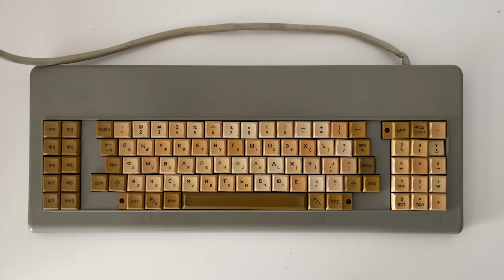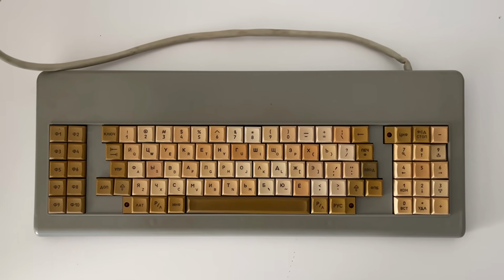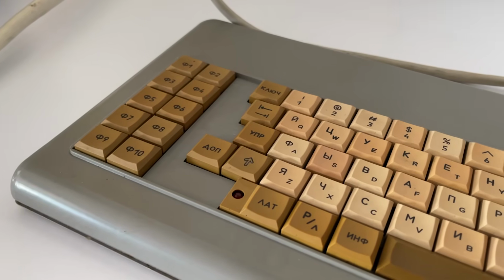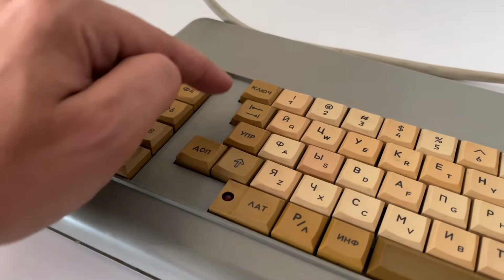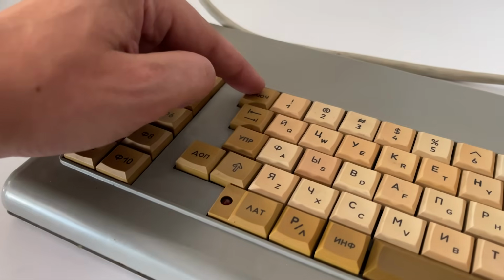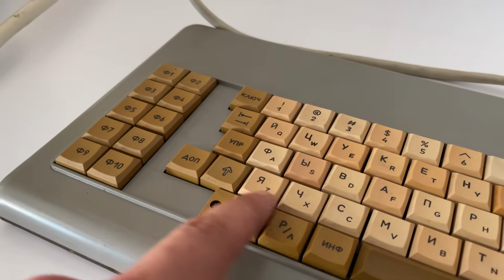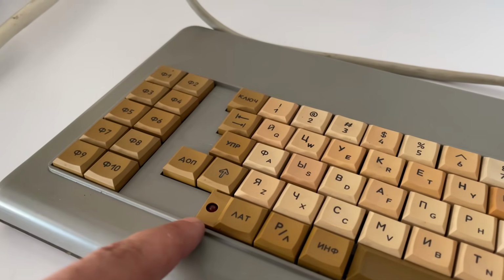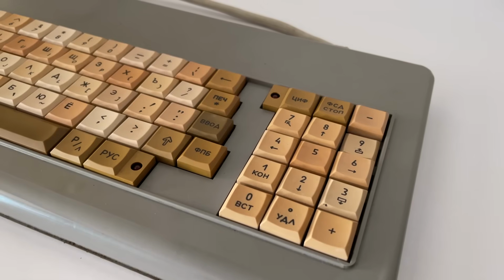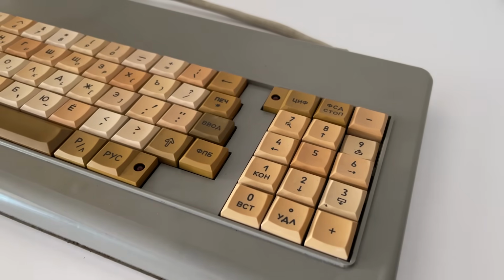And a few words about the keyboard, because it's a little bit unusual. It's a Soviet rework of a PC keyboard, it's Hall effect based, and many buttons were renamed, and some such as F11 or F12 are missing, so there are only 10 function buttons all in all. Escape is called a key, control is called upper, alt is called dop, which is a shortening of the word for additional in Russian, and there are also separate language switches. There are 2 lock buttons for Cyrillic and Latin, they have LEDs, and this R/L is for quick layout switching.